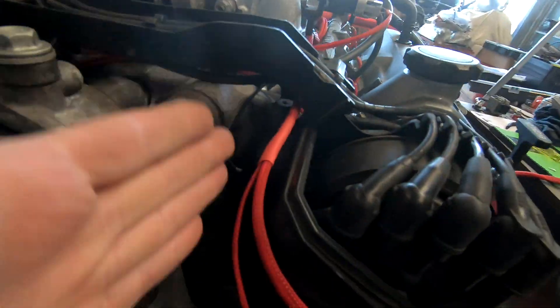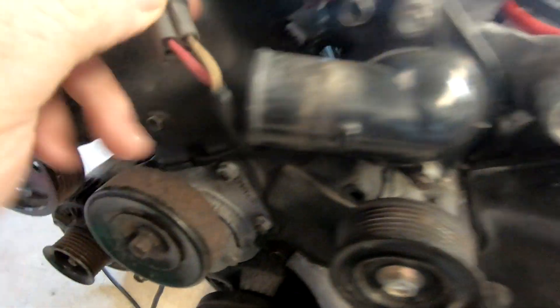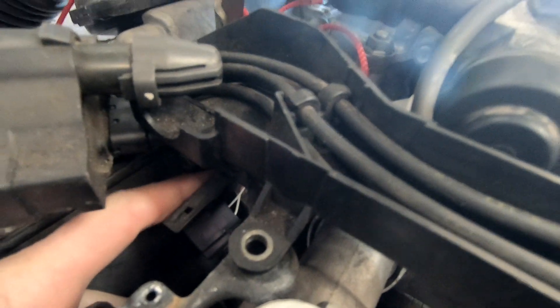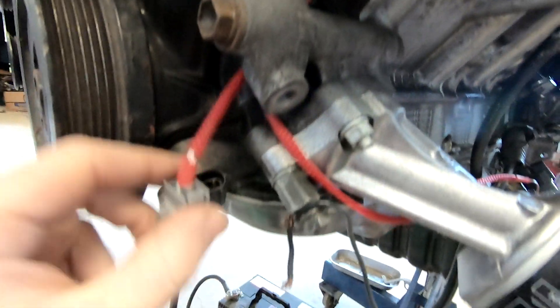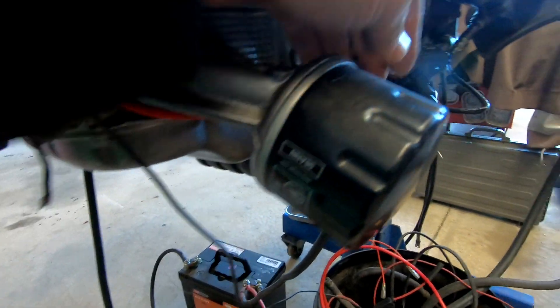Battery coil. You'll notice over here there's no wiring loom coming to this cam angle sensor — that's because it's tucked under here now. I've made it so it doesn't go past the pulleys, and I really should plug this one in — yes it does need to be plugged in. It comes around the front here — cam angle sensor — pops down to the factory coil with noise suppressor, and I feed it down and through the back here to the crank angle sensor.